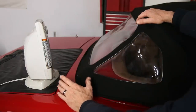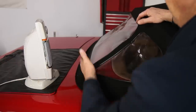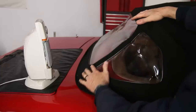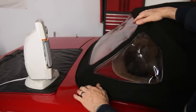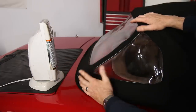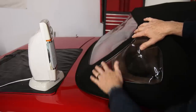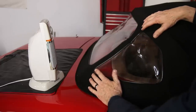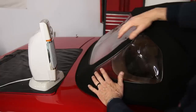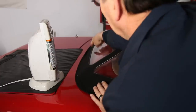A word of caution: when you set your heater up to warm the back of the top, don't walk away and disappear — you might come back with a melted rear window. You want this whole section to get warm, not hot. It shouldn't be so hot that you can't touch it or you'll damage these windows. Move the heater back and forth and monitor the heat. This could take up to an hour for the plastic to start getting really soft — you'll feel it. Then you can try to latch that front corner in. If that doesn't work, latch the front end first, then get two heaters and heat the whole back section to latch that rear pin.